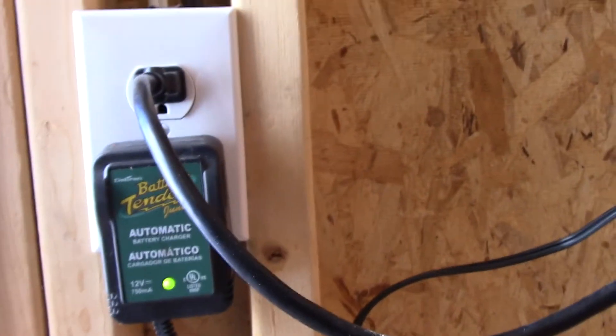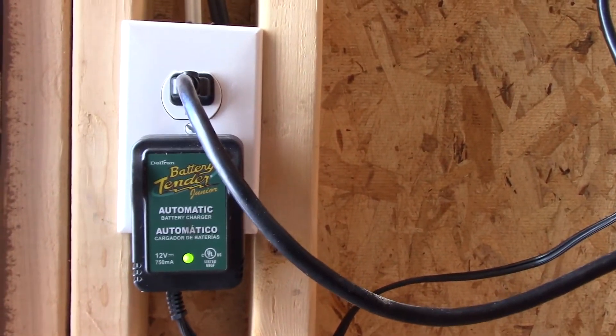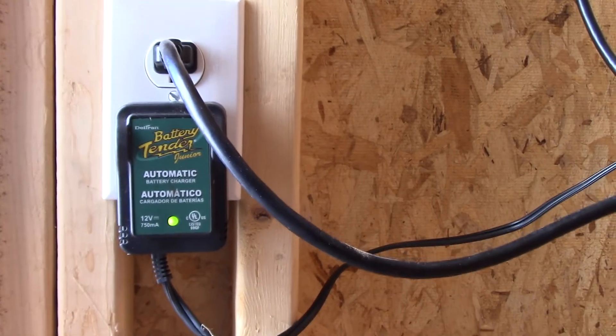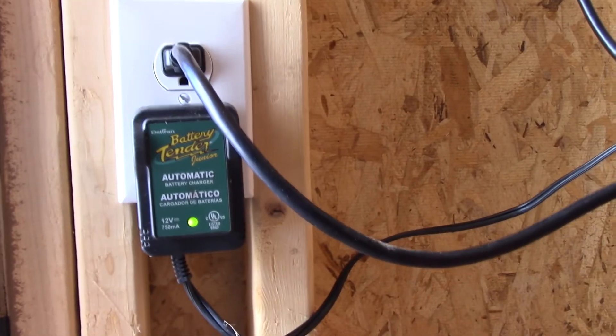The other one on my wall is a battery maintainer called Battery Tender — that's pretty much my go-to now. I won't buy any other. It's foolproof, spark-proof, you can't hook it up wrong — it is just terrific. Now, that's a brand name, and regular viewers know I don't sell anything; I'm just reviewing things I've bought myself. I do watch a lot of YouTube, and I've come across many friends who bought low-cost chargers — $10 chargers and maintainers — and two of my buddies actually had fires in their small shops where these things melted and had what looked like an internal electrical fire.